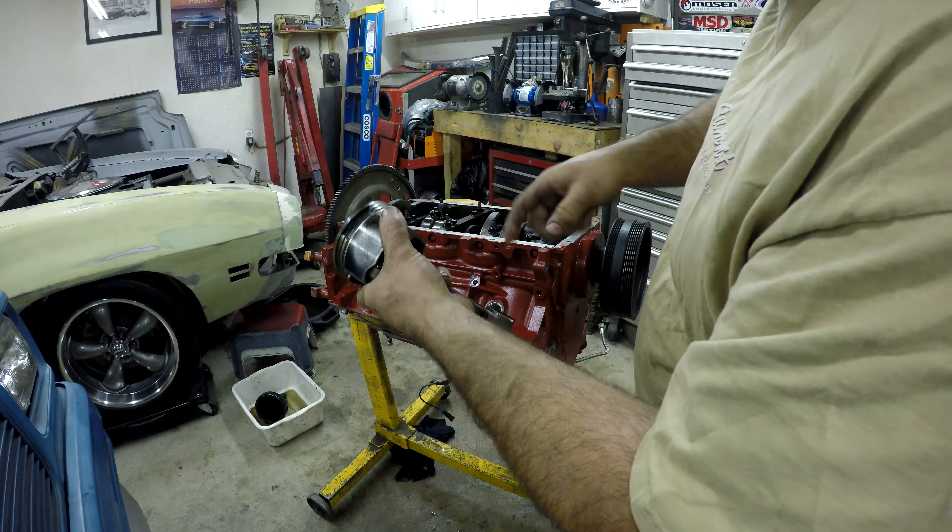Now I just got to get a couple of bolts in there to bolt it together and then I can put the engine mounts back on. I was actually planning on stopping working on the truck, but then I started adding a part and a part and pretty much got it all back together. The only things I still have to do are the starter, the torque converter bolts, the transmission bolts, tighten up the exhaust, and put the turbo blanket on — then it'll be ready to run. It went pretty fast. It's been super cold here lately but today was beautiful — about 24 degrees Celsius. Next video we'll get this thing running again and hopefully take it out and drive it. I still want to take it to the weight scales and weigh it.